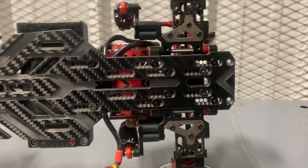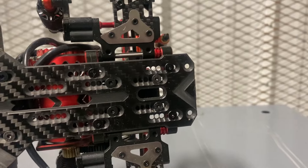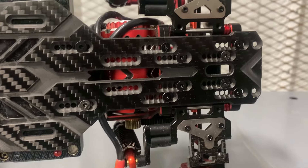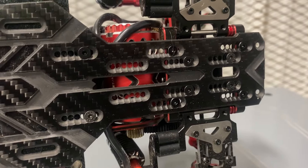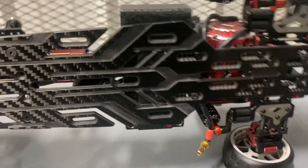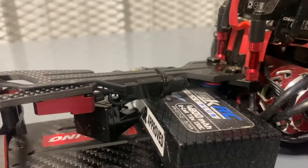All the adjustabilities are over there — so many different things. The whole wheelbase can change right here, and you can move the transmission out without moving those suspension arms. You can slide everything even more forward, and you can move your whole front flex plate — that whole brace can move forward as well.